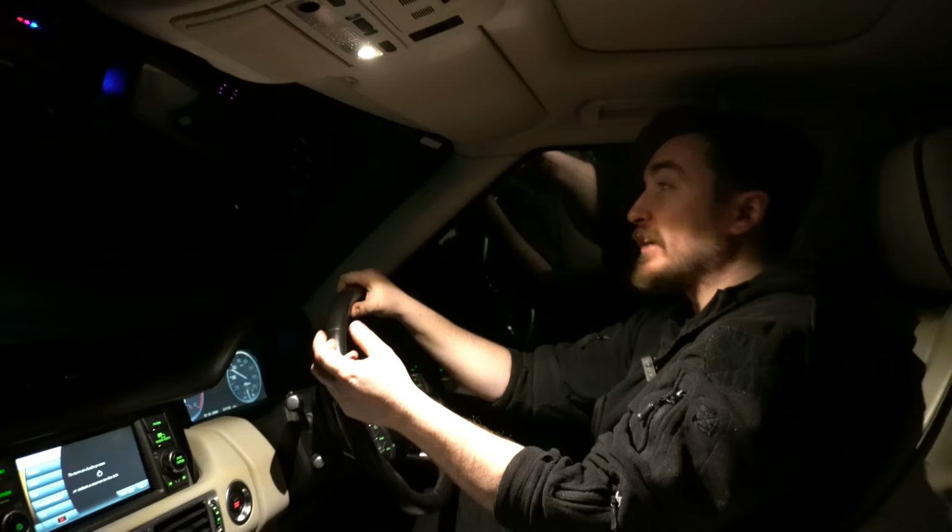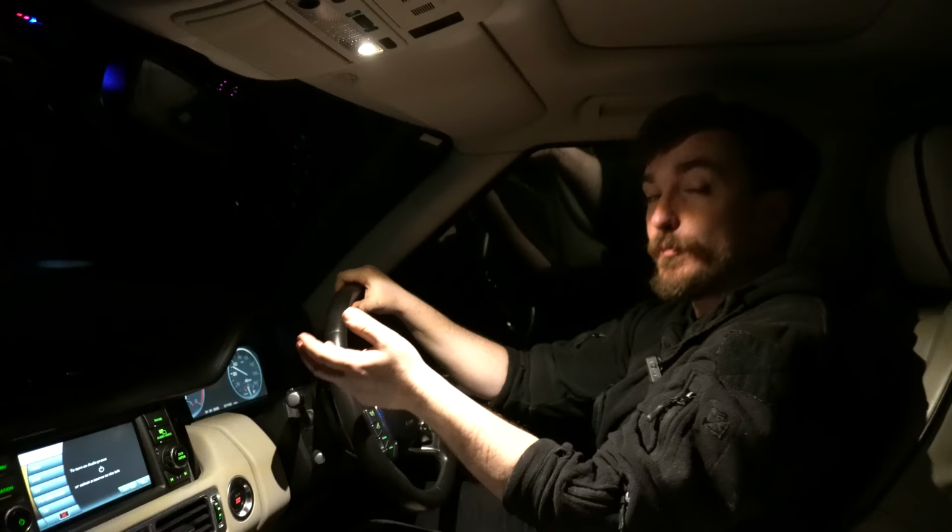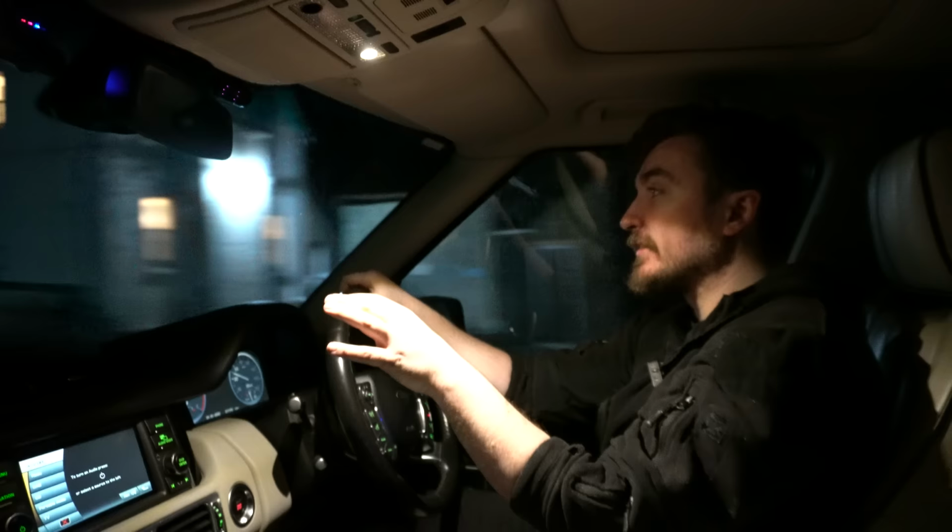Well, initially I just wanted to sort that belt that was squealing on startup, and it seems like we've done that so far. It'll remain to be seen whether that belt continues to wear okay and whether it starts to wear out quickly again like the last one did, but hopefully adjusting the alternator and reseating all of those pulleys has sorted the issue out.